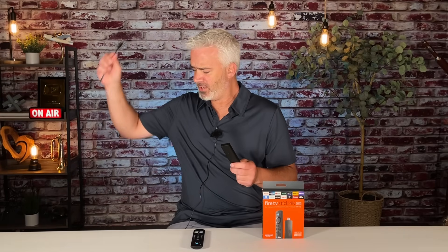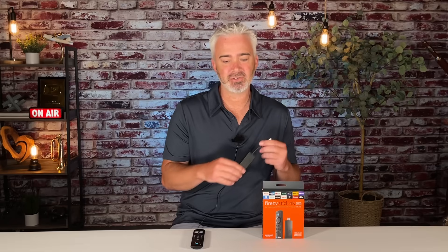The easiest way to solve this is simple: just unplug the Fire Stick from your TV and unplug the power cord — this little guy right here is what actually powers your Fire TV Stick. Leave it unplugged for about 60 seconds just to be safe. Go have a sandwich, come back, plug the power cord back in, then plug it back into your TV. There's a good chance that's going to fix a lot of your problems. That's considered a hard reboot.